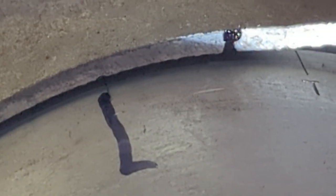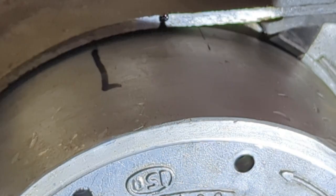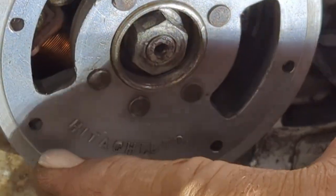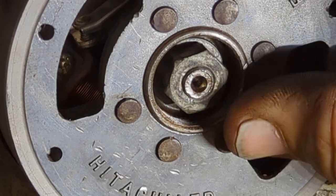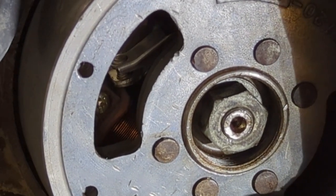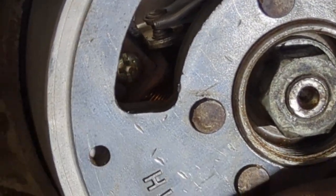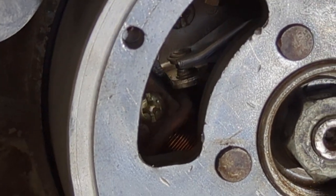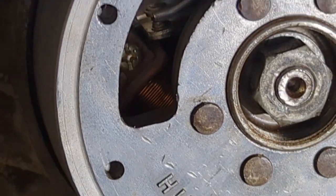All right, so now, what you wanna go do is inside here. Just move on down. And inside there's your points, and they should just be cracking open at the F mark. And I'm trying to look behind the camera. Yep. Perfecto. They are open. Start opening right at that timer.